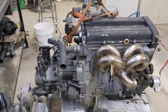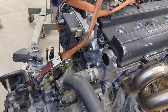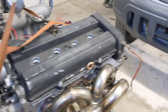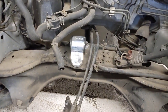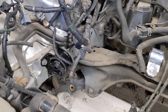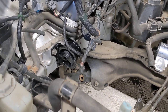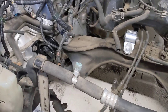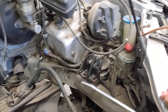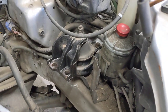Got the transmission and everything looks to be up and ready to go. We've got the CRV inside. I got the Hasport mount on the back, and went ahead and did an aftermarket new mount on the side — that one was blown out. The rear mount on this one was actually blown out too; it just fell right out. Sad days. We got a new mount for the driver's side.